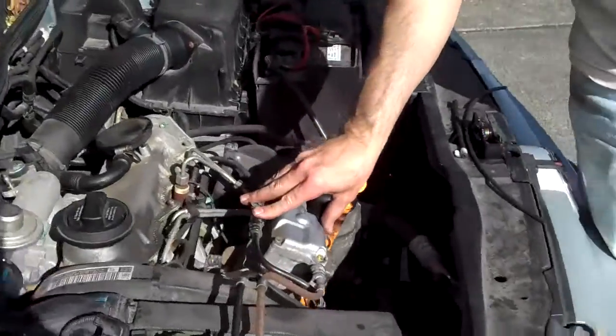We've covered the particulate traps, hoses, and compatibility. Injection pumps — we as a nation switched over to ultra-low sulfur diesel at the beginning of 2007, and just about every leaking injection pump has had ultra-low sulfur diesel in it at the time. The ultra-low has a shrinking effect on the seals, and biodiesel has a swelling effect. We've got a video about healing an injection pump with biodiesel. Almost all the leaks that we've seen have had ultra-low in them. There's a document on the Chevron website that talks about hoses, gaskets, and seals.